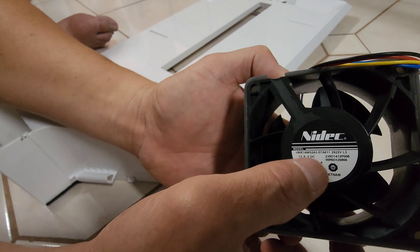Let's get this piece put back into the fridge. Line it up — there are several clips here, make sure they all get clipped in: one, two, three, four, five, six, seven, eight. Check the alignment mark, line it up, and also the bottom one — they all get snapped in.